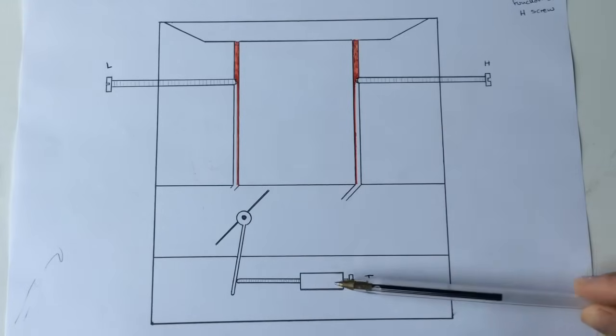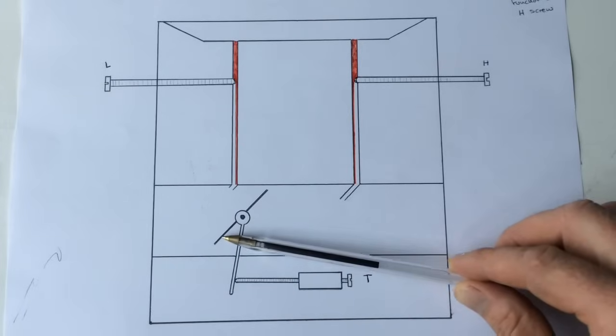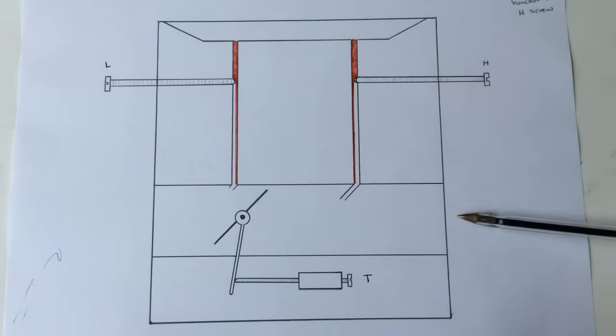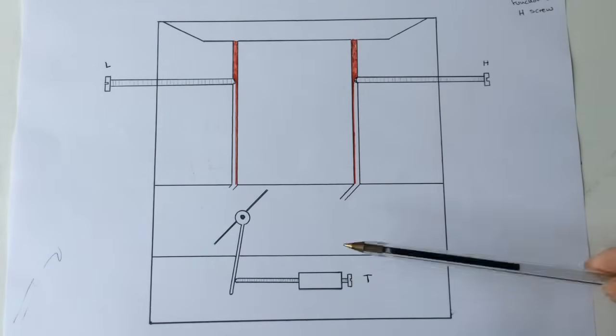This is the tick over screw here, and basically a tick over screw normally pushes straight onto a special plate that's attached to the butterfly inside the venturi. This butterfly is responsible for the amount of airflow that comes through and into the engine, so adjusting the tick over just a little...